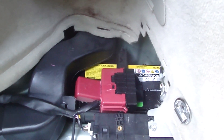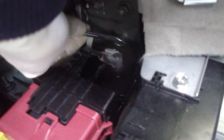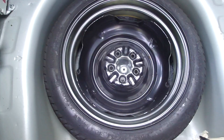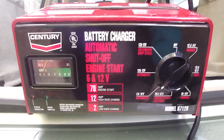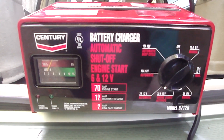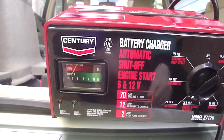Take the battery cover off, pull this thing out and lift up — there's the battery. Use a 10-millimeter wrench to loosen and remove the negative terminal. I'm glad I checked that spare — there's only 10 pounds of pressure in there. When the dealer says they check everything, they don't really. I got my charger hooked up; hook up the charger before you turn it on and plug it in. I got my charger set to 12 volts, 2 amps. I've been reading that you should never charge more than 3 amps — some places say 2 and a half amps — because it could damage the circuit. So this is good. Let's turn it on. It's on.